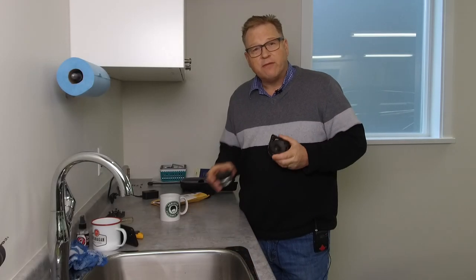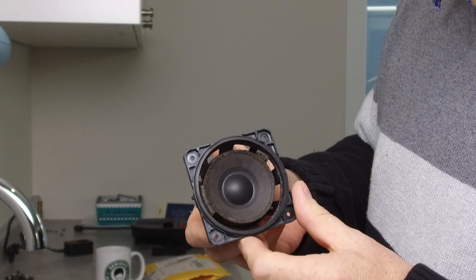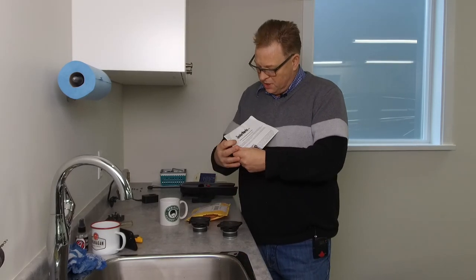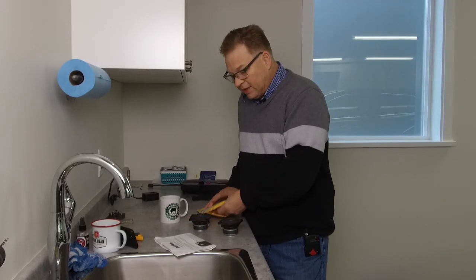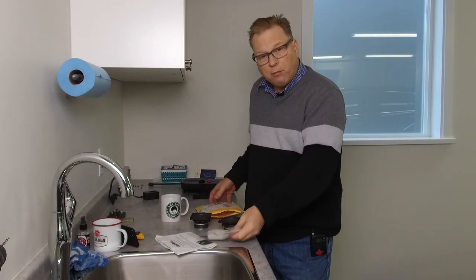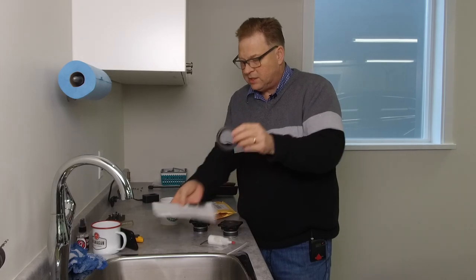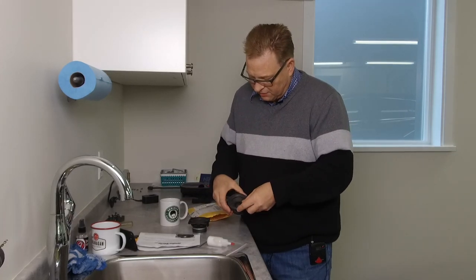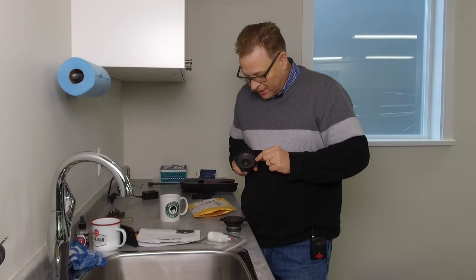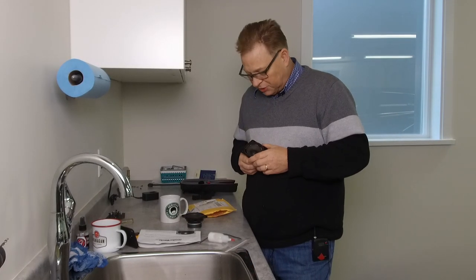I've got the speakers out of the car. Now what we're going to do is take this spacer out, remove the rest of the foam gasket, and replace it. This is what I received from a company called Speakerworks.com. There is some glue that comes in the package along with a little foam brush, and also in here is the replacement foam gasket, so it fits right in there. I've already done this one to make sure I got the technique down, and you can see it's looking really good. So let's go ahead and I'll show you what we're going to do.